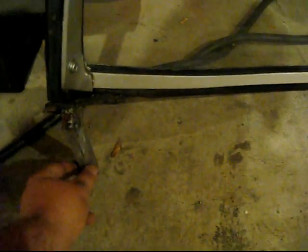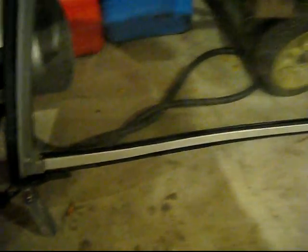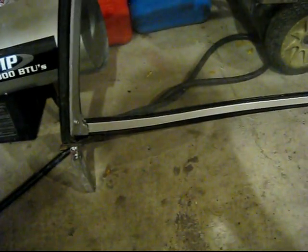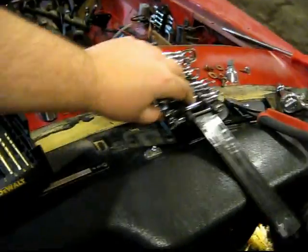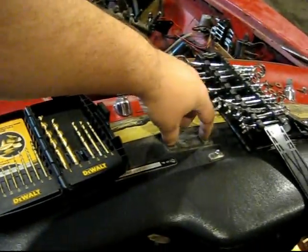You can see here there are these two brackets that kind of extend down into the body of the car. There are two bolts on here — I'll show you where those are on the car. Right here in the center there were two bolts we had to take out, and then two bolts on the other side. I managed to do it without taking the dash off and those two bolts in the center are just right here — those come right out.